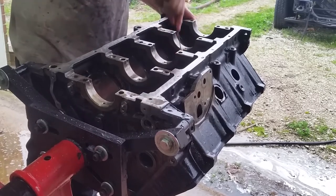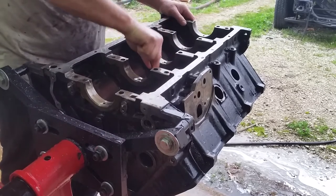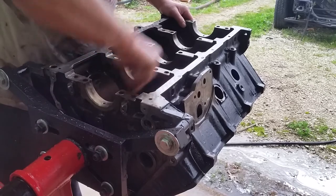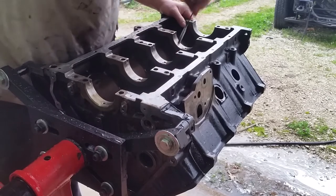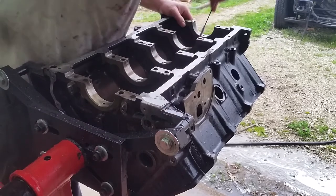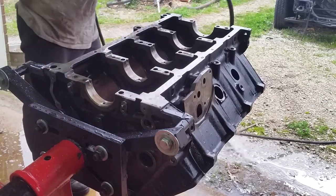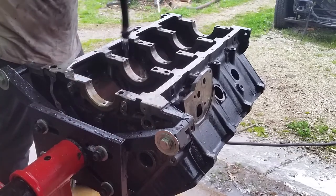Well, we ran the hose in that engine, put one of those press down power flush kits on it, and ran water through it for about a couple hours. Finally got all the soap out of it. And it ran fine after that. Kind of funny though. So if you wash your block with soap and water, be sure to rinse it good. Otherwise you'll have suds mix.